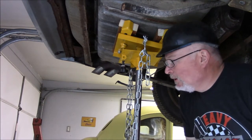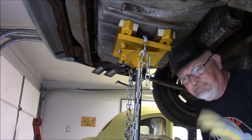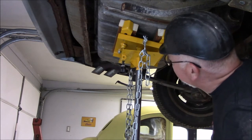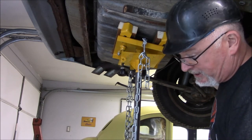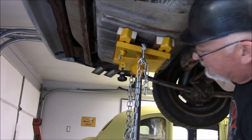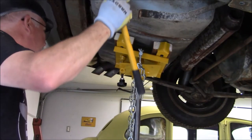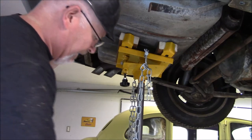I couldn't get the straps out all the way but I took the bolts out and loosened them enough to get them out of the way. When we get the tank out then we can worry about removing them fully — I just didn't want them getting all bent up and distorted. We're going to try lowering the tank now. Keep in mind there's a fill neck that goes up behind the license plate. Also, it's common sense but worth saying: make sure you get the gas drained out of the tank before you do this. One of those little siphon pumps from a tractor supply store comes in handy for that — they usually only work once or twice on gasoline because it destroys the pump, but they do the job. We've got to be careful not to go down and rip out the sending unit wire.